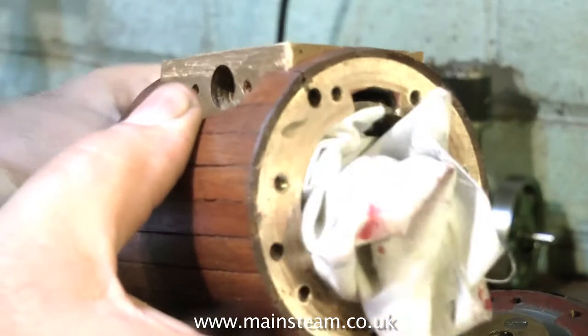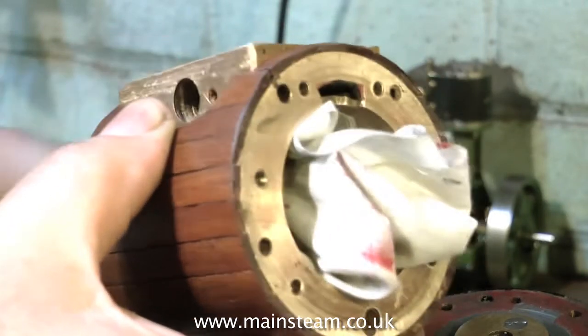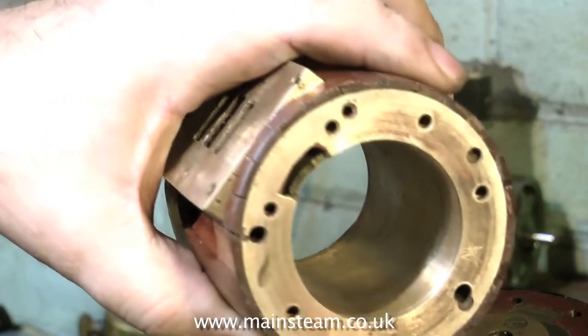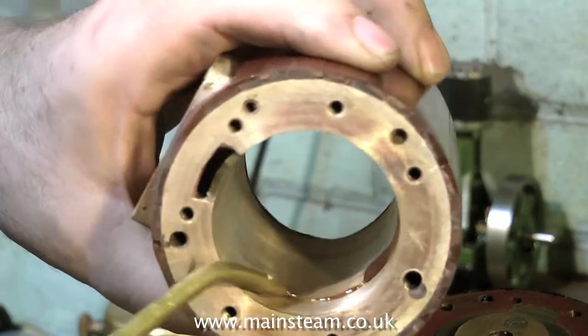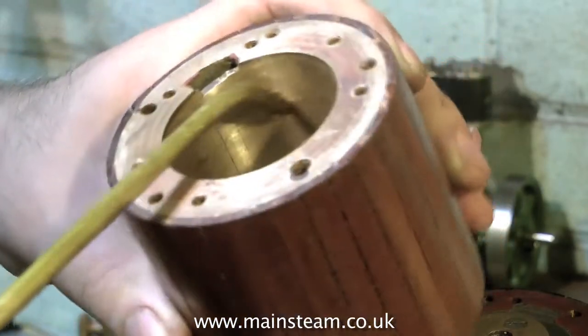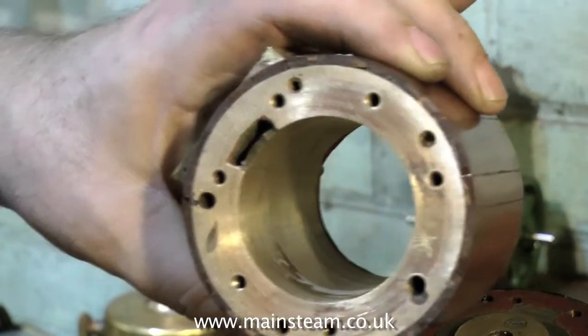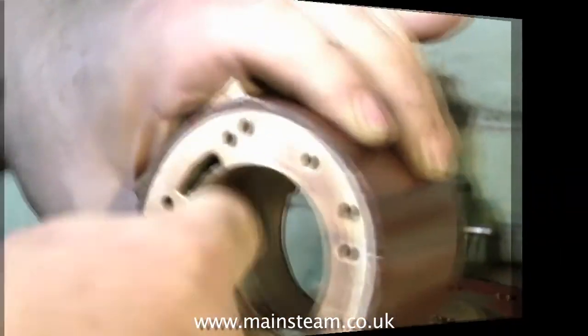Time to see if the cylinder fits on top of the piston. First thing is to clean out the cylinder because it's full of dust and grime from being on the bench, and then thoroughly lubricate the metal parts. These cylinders were originally put in a bath of cellulose thinners so as far as grease is concerned they are squeaky clean. So now some lubrication is required to make sure that you do not prematurely wear out the piston rings.